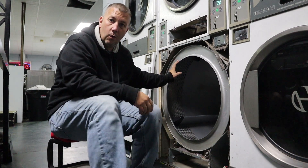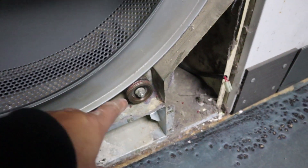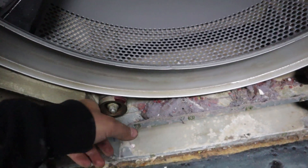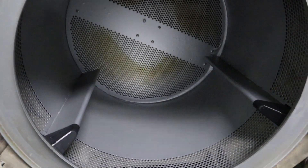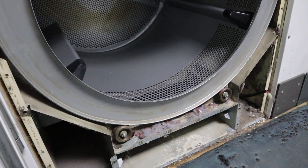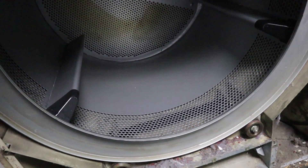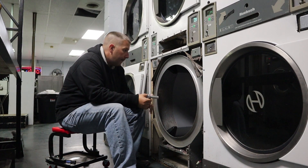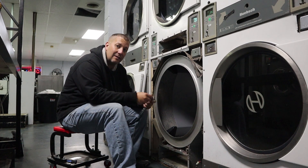I'm going to show you what is broke. See those wheels there? The rubber is completely missing from that one. That should have rubber around it — those skateboard-wheel-looking things. Here's a piece of the rubber right there, that's all that's left. Once they start eating up they go fast — this thing literally went from not making any noise to making a ton of noise like overnight. You've got to take care of it before it gets really bad. You'll need a nine-sixteenths socket; in these dryers you'll need five-sixteenths, quarter inch, half inch, seven-sixteenths, nine-sixteenths, and seven-eighths.